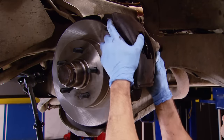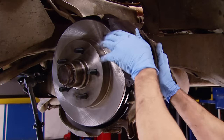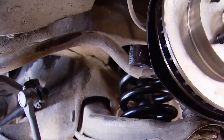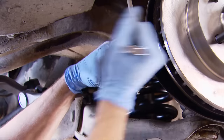We reinstalled our high-mileage but still-functioning brake calipers, secured the bolts, then finally added the tie rod end and locked it down into place. But we stopped short of adding the sway bar end links because we've got another upgrade in mind — we'll get to that later.